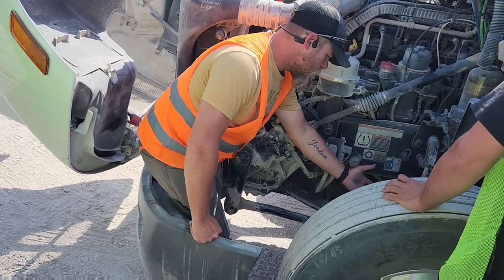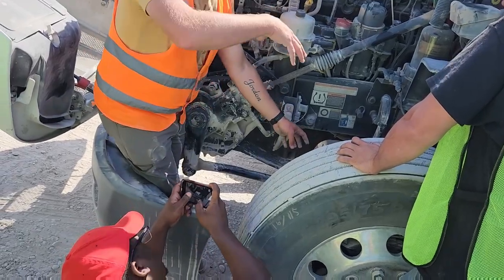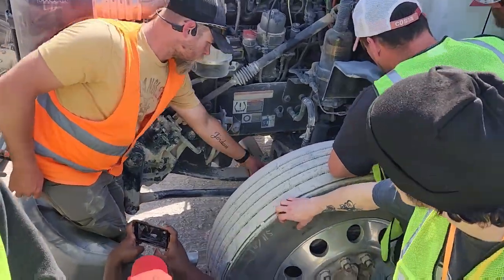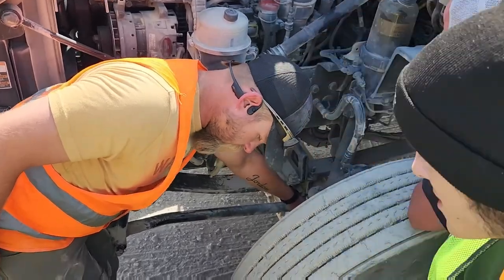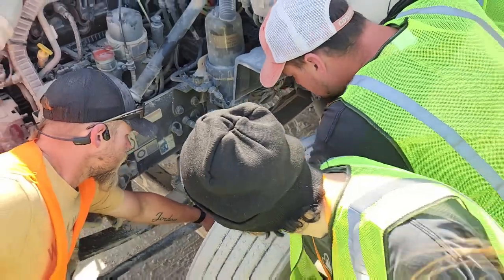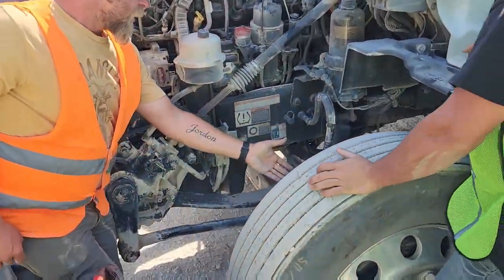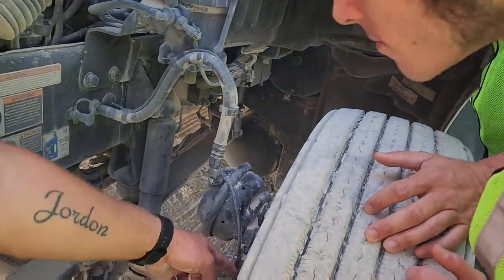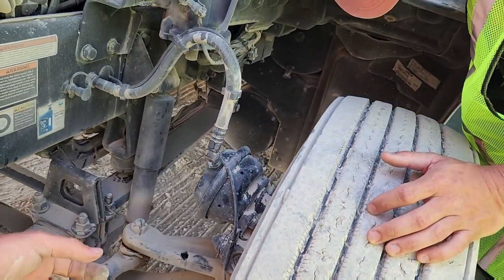And then you have your steer arm, which, y'all have to come over here and look. It is the piece coming right here. It's this. Steer arm. It's properly mounted right here. Okay. It is properly mounted and secure. The castle nut is present. And then my steering knuckle, which is just up here inside of the tire. It's underneath this. It is properly mounted and secured.